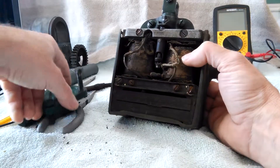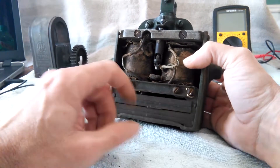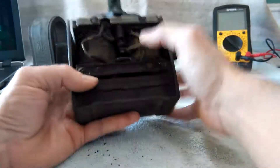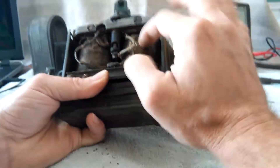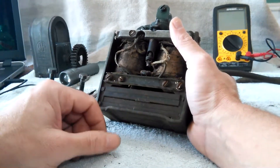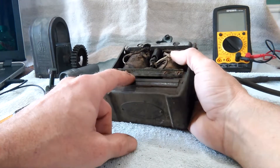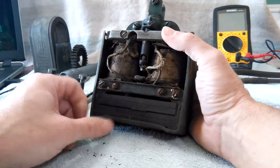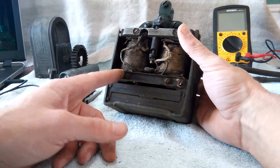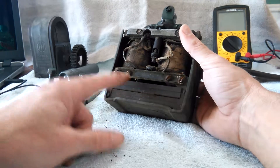With that, I'm going to start up another video and we're going to tear this thing down and take a quick look at it, maybe check the coils as we go just to see what's going on. You can get coil rebuild kits for these — do an internet search and you can find the coils, contacts, and condensers. There are a few different types of condensers I've seen in these. This condenser in here looks original; I'm going to guess it's probably bad. I can't check the condenser because I don't have the tester for capacitors, so I'm just going to scratch that up as being bad.